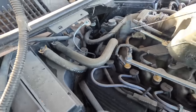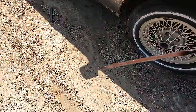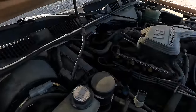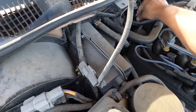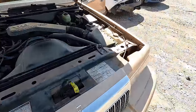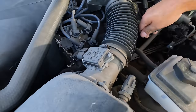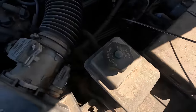Let's pull the trans dipstick — you can tell I'm serious about this one. It's dark, not bright, but it hasn't turned brown and it's not black yet, so transmission fluid looks okay. We've got coolant, trans fluid — I'd love to know if we've got oil as well. And we do — nice golden oil, full. All right.